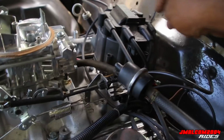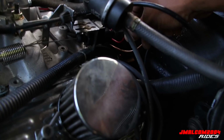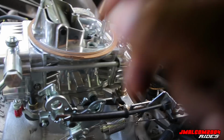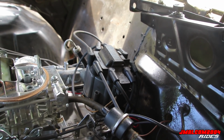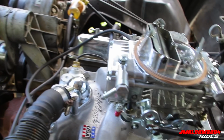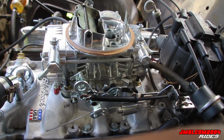After I take that loose, I'm gonna hit my oil sending unit, which is a 7/16. And after I get all that out of my way, I can reach down here and hit my top transmission bolts. Man, I got so much clearance, especially over there. So I shouldn't have to go under the car really today, except doing torque converter bolts. But yep, that's my plan. I'm just explaining to everybody, and then I'm gonna check back in with y'all. So stay tuned, y'all. We rocking and rolling.